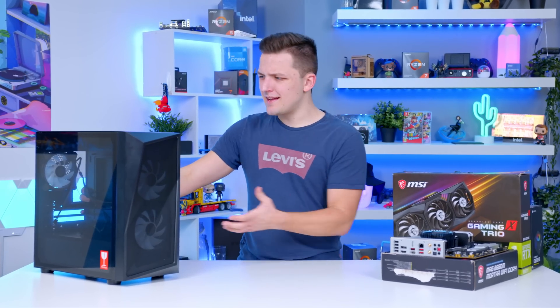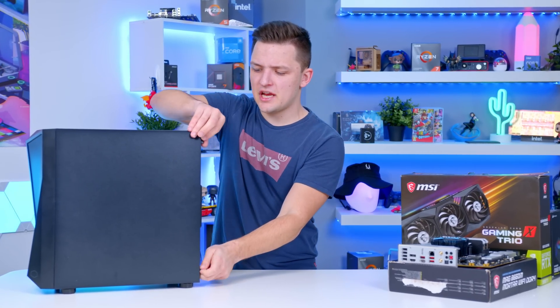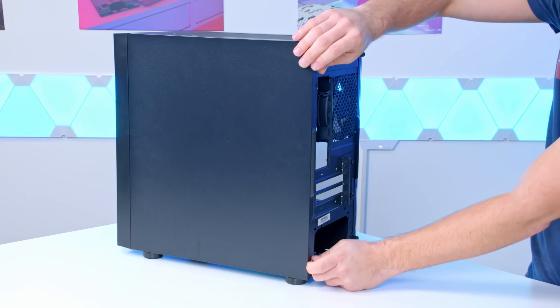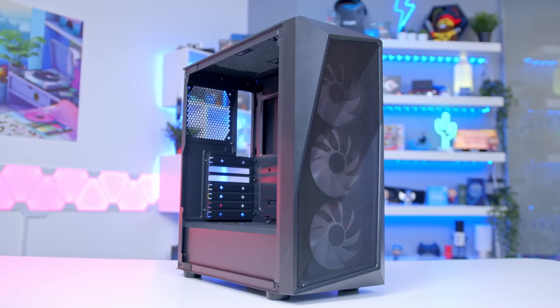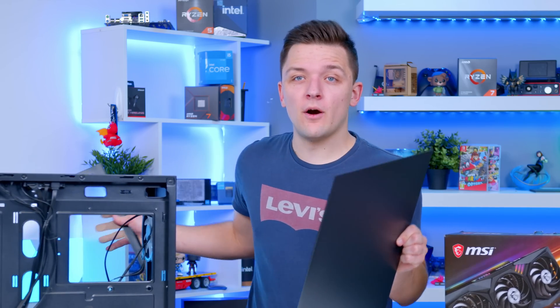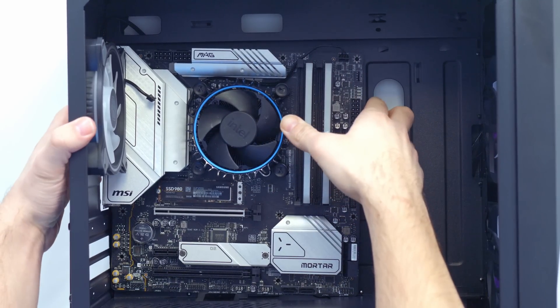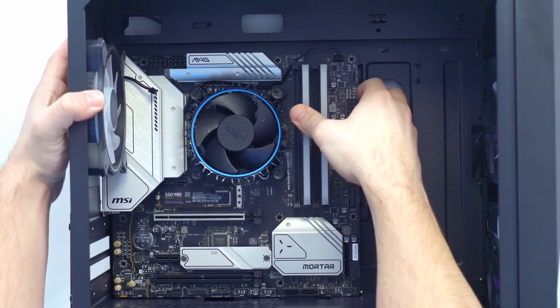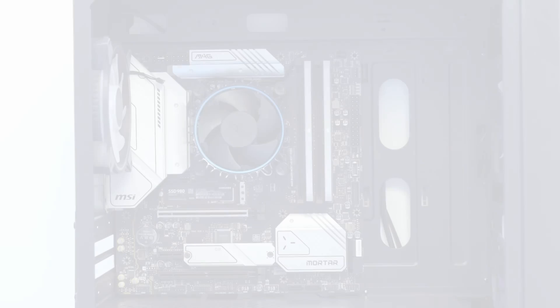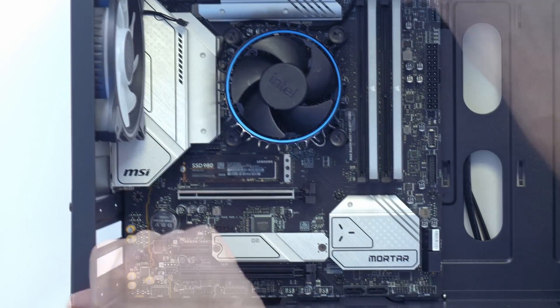To go about doing this next stage, take your case — in our instance the Cooler Master CMP 320. The bigger CMP 520 also impressed us when we had it in. Strip off all the side panels as taking these off makes the whole build much easier to access. The board will then slide in from the top of the case and sit on all of the available standoffs, highlighted by white circles at the top, middle, and along the bottom of the motherboard area.